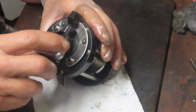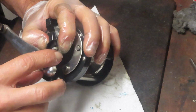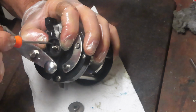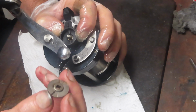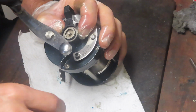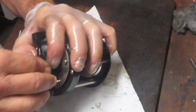When you're doing this, you want to always install your tensioner off the free spool release. You want that in action there. There's 2 pivot points on the swing arm. You'll see them here and here. You want to make sure when you take the preset collar, or whatever this thing may be called, that you nestle it over the pyramids. Once you do that, you can put the spring in the middle, grab that adjuster button, and tighten down.